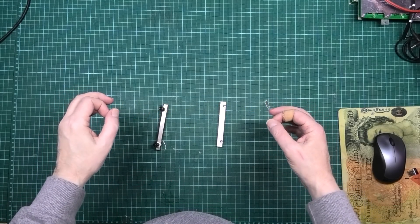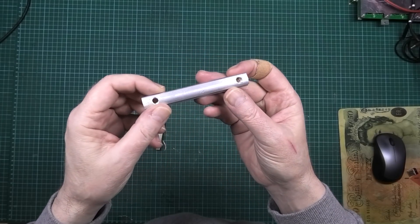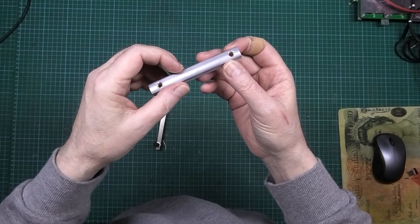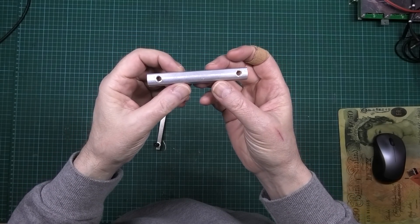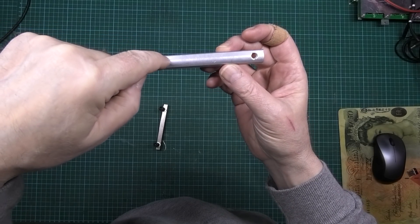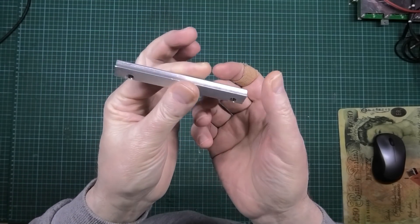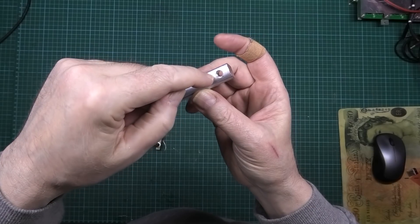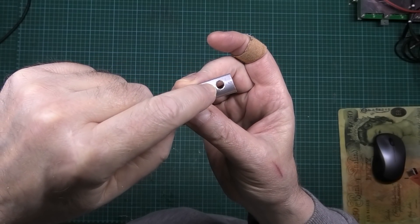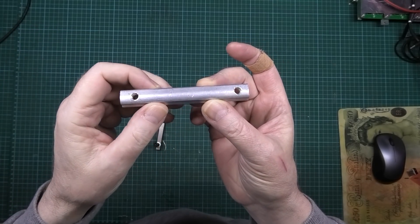This is the original mounting for the seat post. There are two of these, one on the left and one on the right. The bolts go through the mounting post, through the frame, and then into this, pulling against it to clamp the post. It used to have M3 bolts but I made them into M4 bolts, and it's still pulling them out when I tighten to the torque I want.